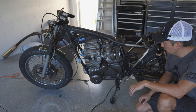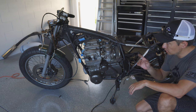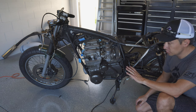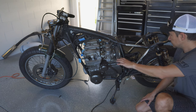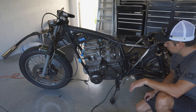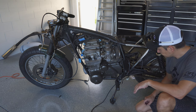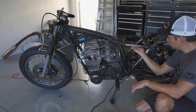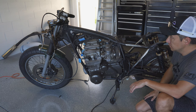I've got all the electronics off — I'm probably not going to reuse any of it. The wiring harness was cut and spliced so many ways I don't think I could track it down; I'll probably just buy a new stock CB650 wiring harness and start fresh. The gauges were strange, the ignition was strange, everything was strange. I've got it all in a box in case I reuse anything. I'm doing some final work in the seat area — I want to keep as much of that open triangle as possible and build a pretty flush pan, with the battery mounting down where the dual kickstand usually mounts and all the other electronics tucked right here.